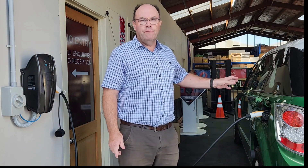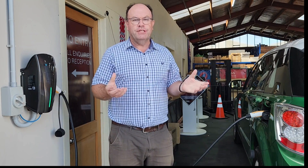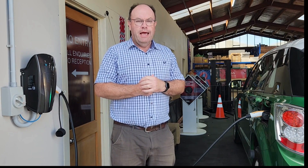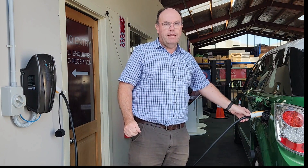Make sure that the car is turned off when you charge — I know that sounds fairly self-explanatory. Also, in the case of some vehicles that have charging timers built in, always remember — and this is a common thing with Leaf and Mitsubishi Outlander PHEV owners — make sure the charging timers in your car are turned off if you're going to use plug and play charging.